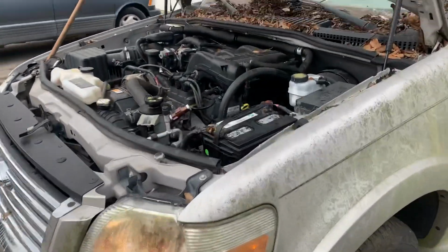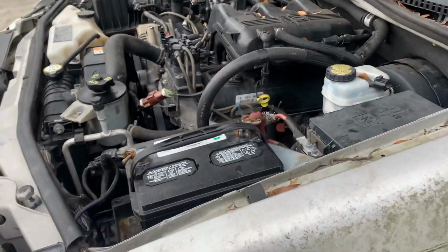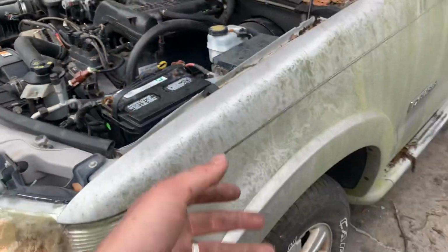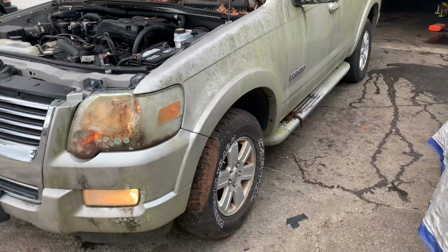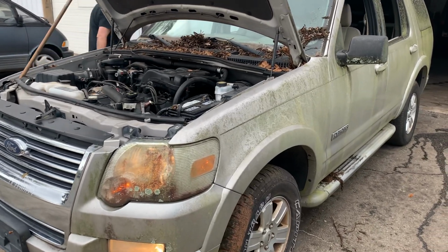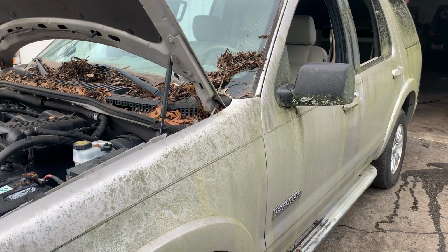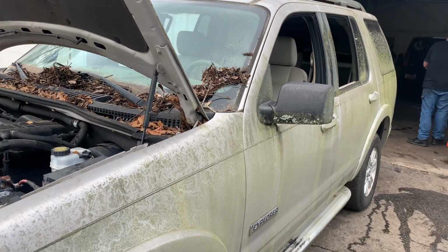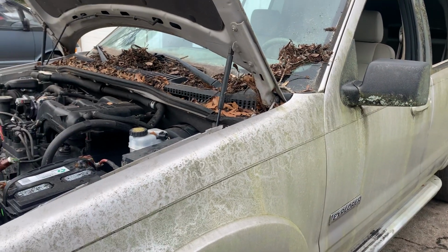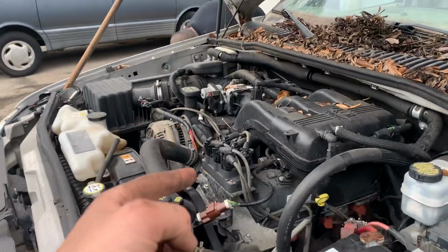As you can see by the lights and the fact that you can hear it running, this engine does now run. So far, we bought it under the impression that it had been sitting for about 3 years due to a dead fuel pump. The crap inside the gas tank confirmed this. Pulled the tank, drained the tank, put a new fuel pump assembly, the whole unit, sending unit and everything in there. $15 worth of fresh gas, spun the motor over, wouldn't hit a lick, had no spark.